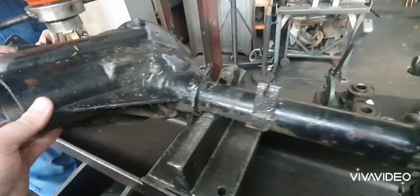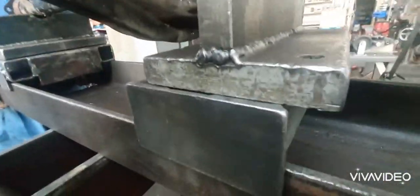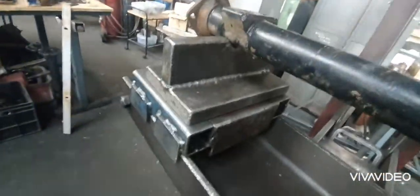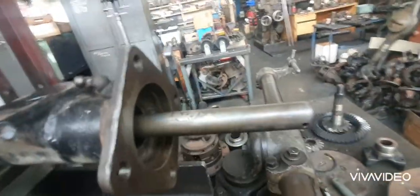So we've got the press. And we've got this frame thing in the press that you put this block on, that block on. See these blocks that hold the diffs. And then you put a diff along there. And then the rod that's in the diff, which is in the bushes, tells you where it's bent.